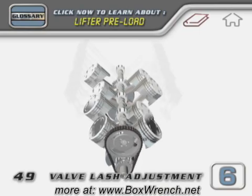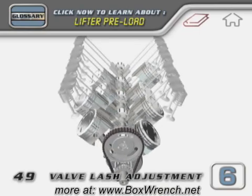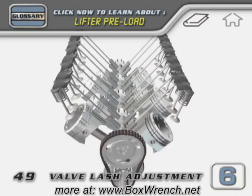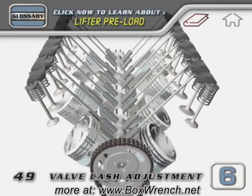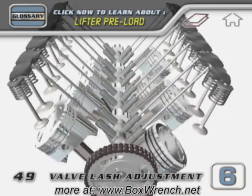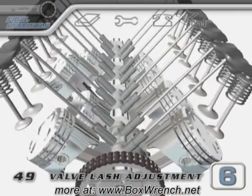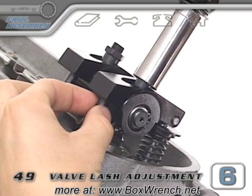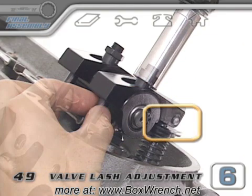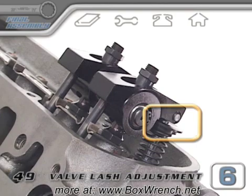When the engine is running and oil fills up inside the lifters, that preload on the lifter is going to be what keeps the valve train from making chattering noises. If you're using hydraulic lifters that were run in an engine previously and have oil in them, you might notice that when you add the extra half turn, the valve might actually open a little bit. This is normal. After a minute or two, if you had a gauge installed, you'd notice that the pressure built up inside the lifter will bleed off and the valve will return to its closed position where it should be.